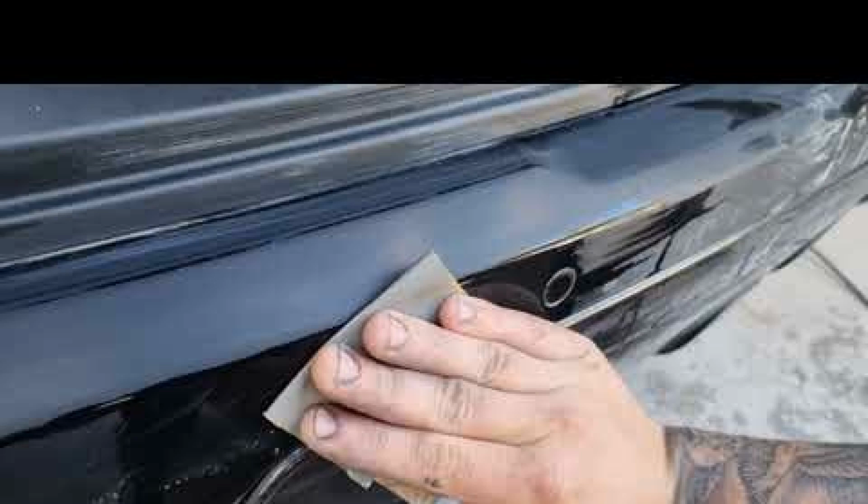Spray on a base coat after polishing the area with a damp cloth to keep the surface clear and smooth, then spray on paint that matches the color of your bumper. Mix the car's clear coat with a hardener. Apply the mixture twice, letting the first coat dry completely before applying the second coat.